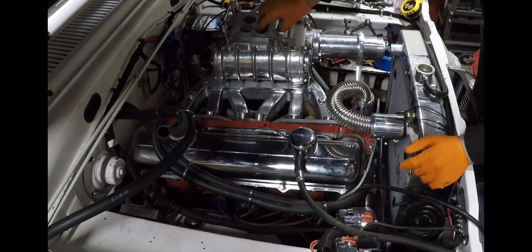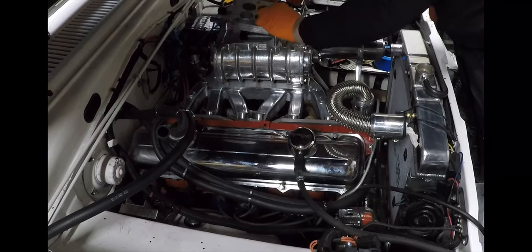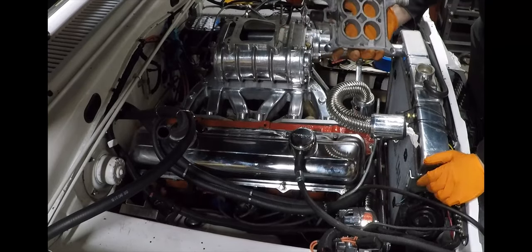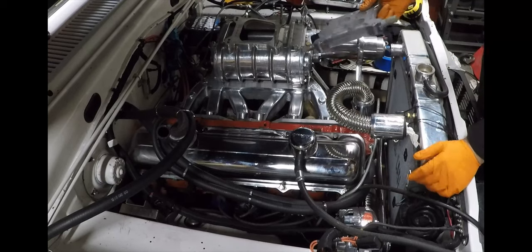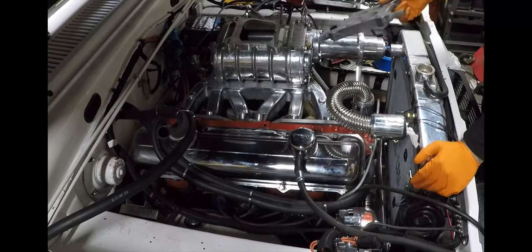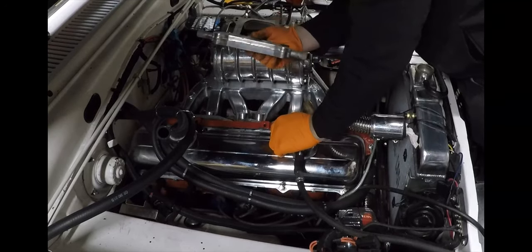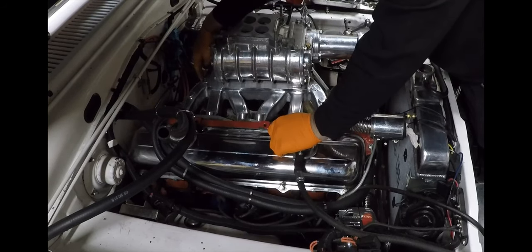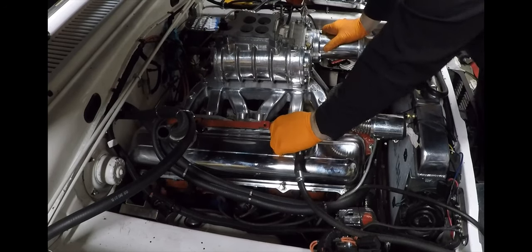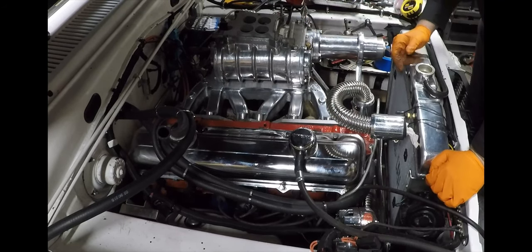This plate is just a pass-through plate for a four-barrel carburetor from a Ford — '65 I think — and it just manifold-heats the carburetor, like a heat riser would on a regular intake manifold. There's no provision for heat from this custom intake, and that's okay. I need to get a fitting to plug the vacuum port here. I might need to go find the correct T-fitting for that manifold vacuum port.